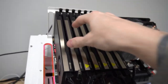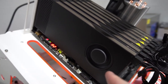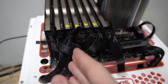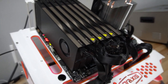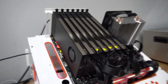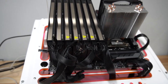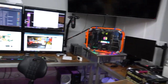So I'll add the copper shims first and see what that does alone. If that's not enough, I'll add two fans. If airflow still isn't cutting it, I might remove the card housings entirely and 3D print a fan shroud to direct air between the cards. Worst case is water cooling — seven water blocks and a giant radiator — which would be expensive and potentially a year-long project. Or submersion cooling. But I really want to make it work with airflow, and then I need to get this all into an ATX case. Let me know what type of case I should buy — NZXT or something similar.